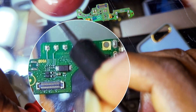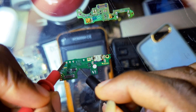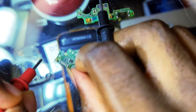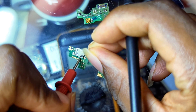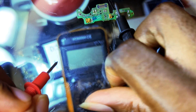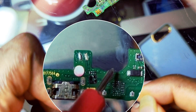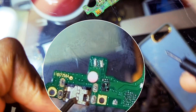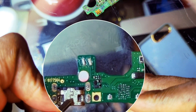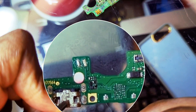Apart from the 5-volt line on this charging port, there is no other component or function that deals with a high amount of voltage, so the bigger line is always that of the 5 volt. The 5-volt line is integrated and passes through the PCB through the other layers, then comes to this side and passes through this diode right here, which is connected in series. So if this line is killed off right here and you want to jumper, you can either scrape it here then jumper, or solder right here — these are the places to jumper to get your 5 volts into the PCB.